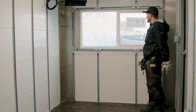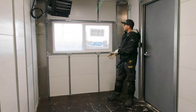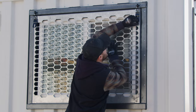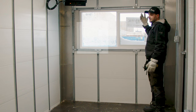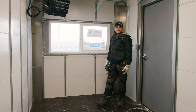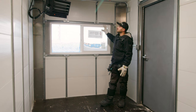For ventilation or visibility, we have our 60-inch end wall window here, though we'll be moving towards a 48-inch end wall window. With these window kits, you might not want a zombie — or someone — able to climb through, so we have steel mesh screens that fold down. It's an egress-style screen where you can open it, drop the screen, and still get out, or have it completely locked for added security. It also protects the glass during transport.